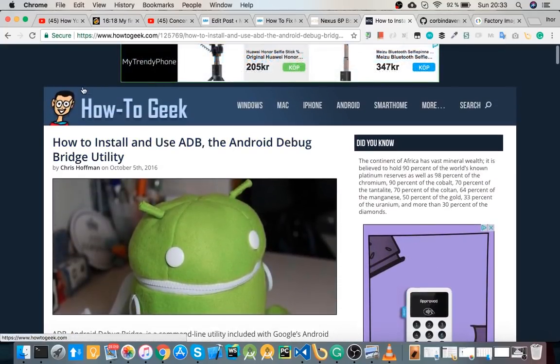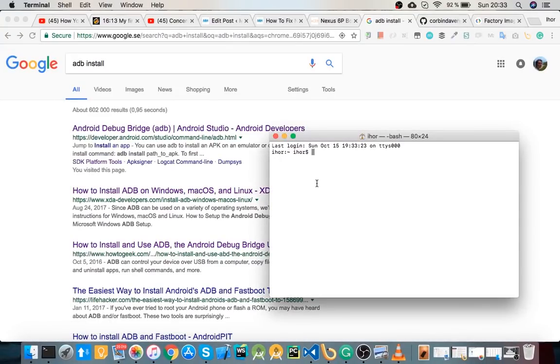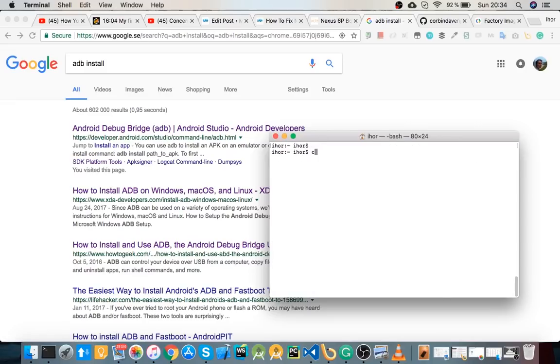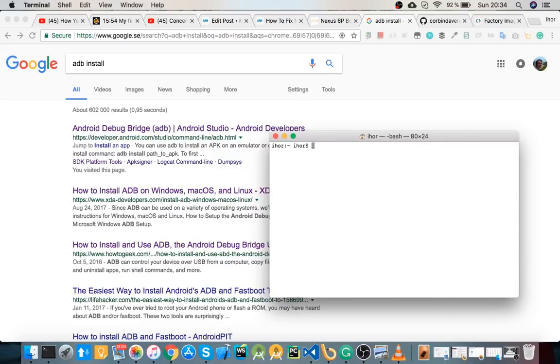So first what you need to do is to install ADB. You can see the instructions here. I'm gonna link it in the description. Then open terminal and check ADB. If it gives this output, then your ADB is installed. And check fastboot. If it prints some output, then you got everything ready, and let's go to the next step.